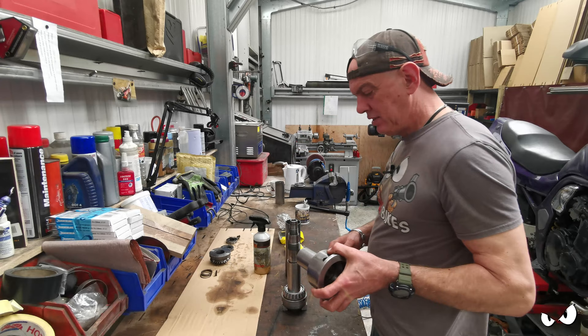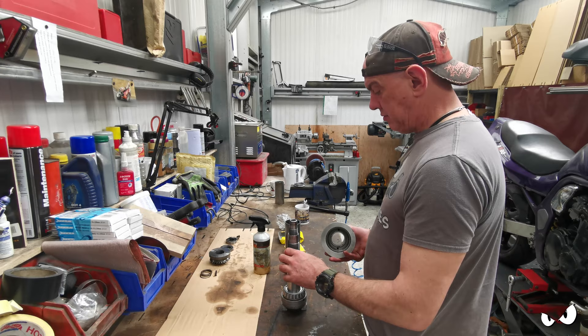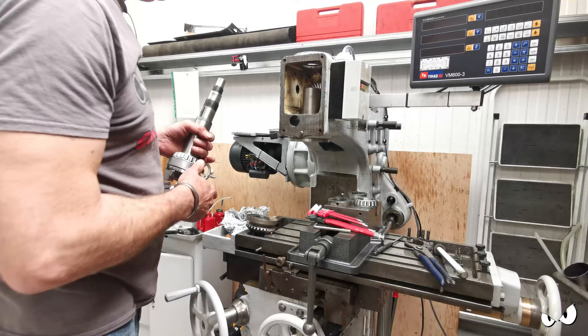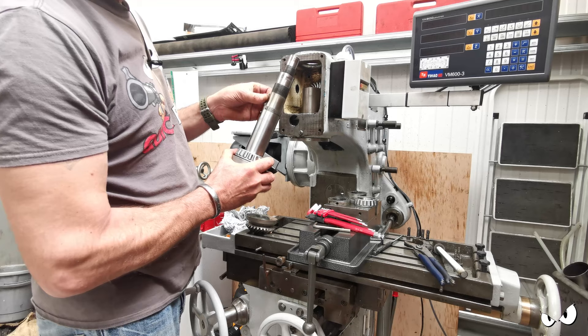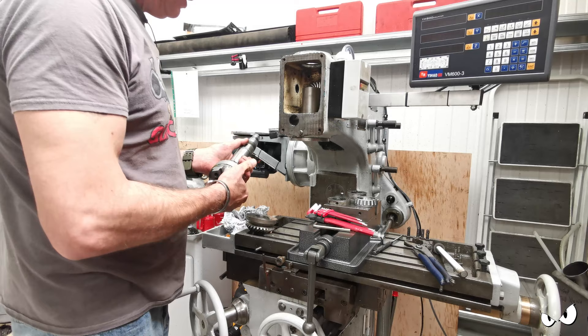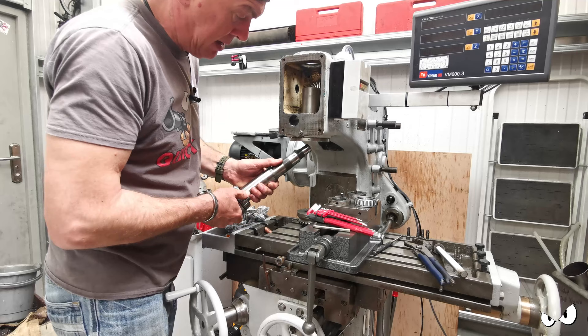The race is all the way down, so let's shove this back up as far as we can and then we need to get this lot rebuilt. Everything's assembled - all I've done is put a little thrust washer, then the spacer, then the key. That's obviously for the bevel gear, and all this lot is going to get shoved up here.